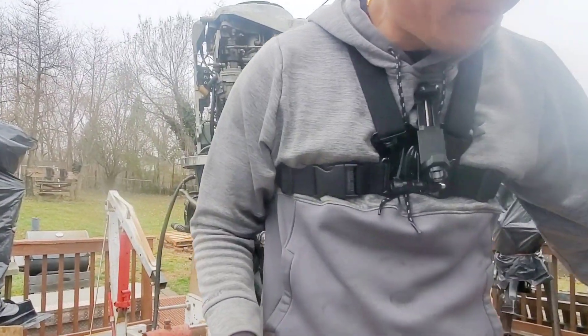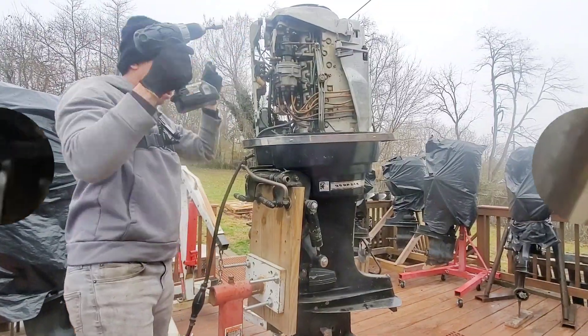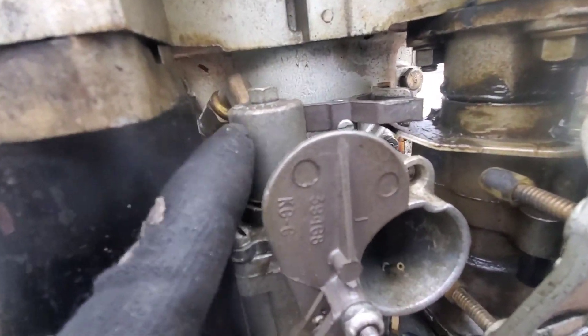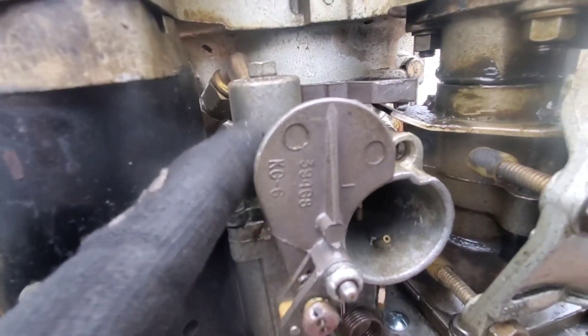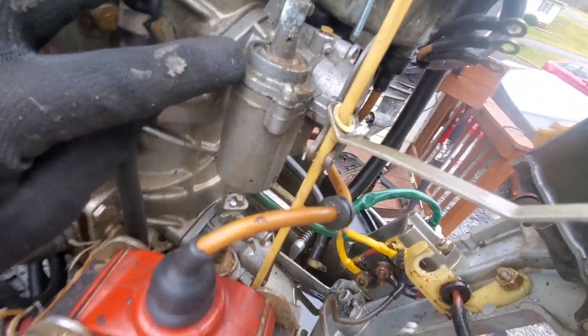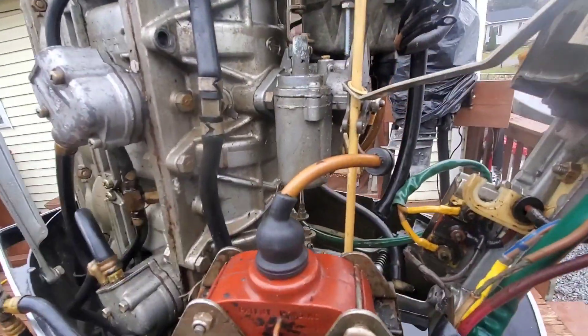I have this bad feeling that I'm going to find something I don't like. I got the faceplate loosened. Usually when you have the filter pre-carb, this one always gets crapped on first — it always builds up before it trickles down to the others. I unscrewed it and I definitely had the outcome pictured differently in my head. It looks like the fuel inlets are pretty much all corroded or jammed. I'm going to do the right thing, pull these carbs, and rebuild them.